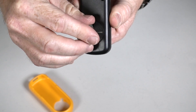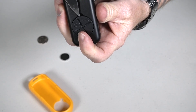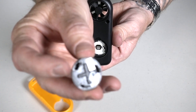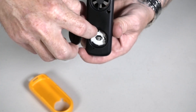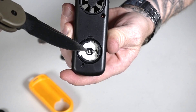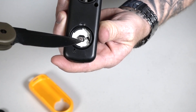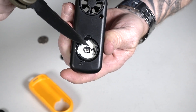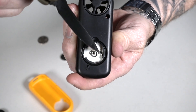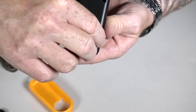It's just a quarter turn counterclockwise, like so — this goes up to the top and it has a little cutout there. You can stick a knife or a paper clip to remove your actual battery compartment. One of the things of particular concern is these little tabs down here will be flattened out — there are two of them. You can take a knife or your fingernail and bend them up just a little bit; that's going to be the negative side of the battery, so they make contact. A lot of people are having that problem. There was also this tab that was actually bent down, which is the part supposed to contact the positive side of the battery — it needs to be bent up into the side, not going under the battery. Make sure it's nice and pressed up flat.